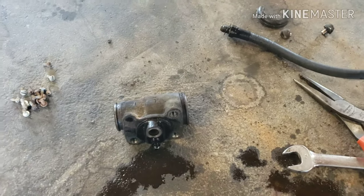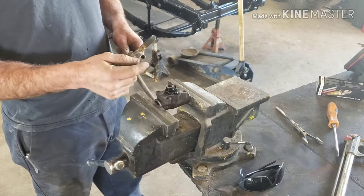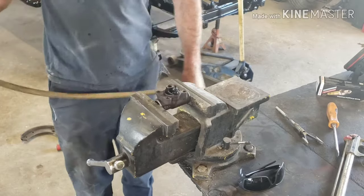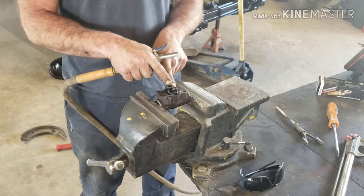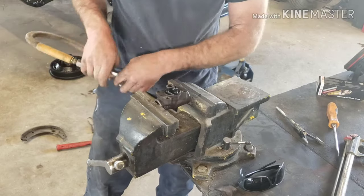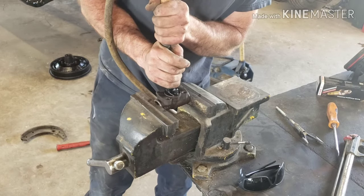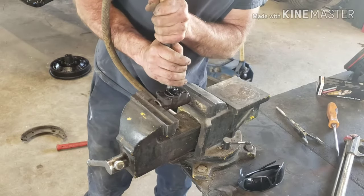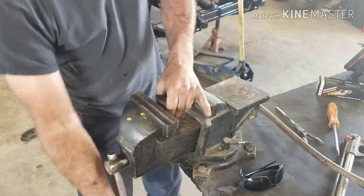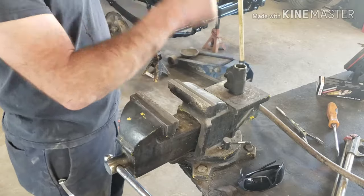We're gonna try something here — I couldn't find my blower that normally has a little rubber tip so I can get a little bit of pressure. It's a little frustrating — I can't find the tool. So I put the wheel cylinder in the vice because when the pistons pop out I don't want them to go anywhere; I just want them to break loose. We're gonna try to shoot air in here and see if it moves. Those pistons are really stuck in there.